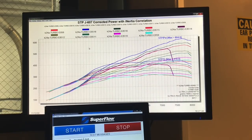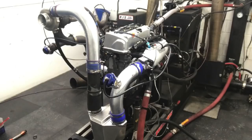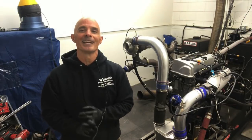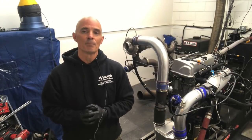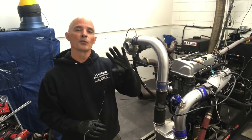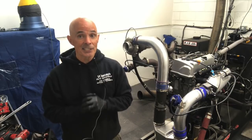Tune in tomorrow. What do you think about part one of our turbo adventure with our K24A2? We are going to do a big bang with this, but not yet. I have to take this thing apart, put ARP head studs in, and put the proper ring gap in it — I have no idea what the original ring gap is, but we're doing it anyway. Later on we're going to put a big turbo on it, the right header, and turn it all the way up with ice water and good fuel, and find out how much power the stock bottom end can actually take.